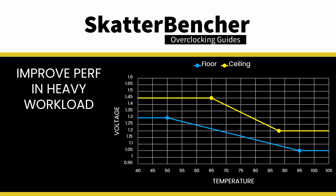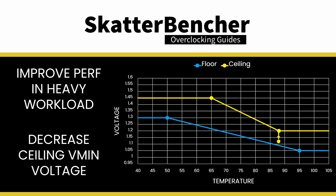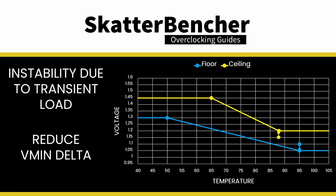The fourth application of voltage suspension is the one I found most useful: mitigating the effects of using a voltage offset on heavy workload stability. As seen in our PBO supercharged strategy, adding a voltage offset made Prime95 small FFTs with AVX enabled unstable. With voltage suspension, I was not only able to get the system stable, but also lower operating temperatures significantly. You can also use voltage suspension to mitigate transient load effects — where workloads switching rapidly between full load and no load create voltage instability — by setting an appropriate voltage floor.